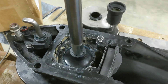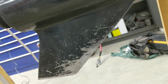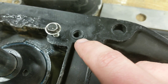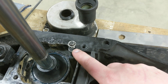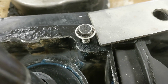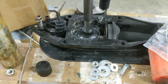Now with the seal pounded in, I'd like to pressure test this lower unit. My understanding is that you can supply air into the fill hole — right there — there's a tiny little o-ring that sits there. I cleaned out some corrosion and junk. This is one of the bolts for the raw water pump, and I'm going to use that with this scrap piece I found — put a bolt there with washers to clamp down and plug that hole so I can put air into it and see if it holds.